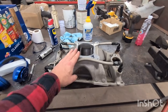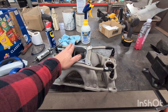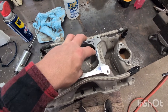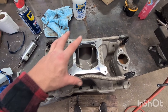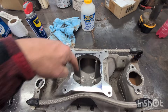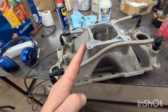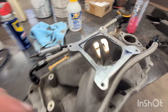So as I'm waiting for stuff to cure, this is what we're going to be working on. This is going on a 421 small block Chevy pump gas hydraulic roller setup. This is not going to spin a tremendous amount of RPM. We are going to establish a little bit better plenum inside here — there are some pretty basic tricks you can use to free up the horsepower. We are not doing a fully ported intake. I'm showing you the meat and potatoes: get this stuff out, you're going to free up horsepower. This is going to get gasket matched to a 1206 — it's already at a 1205. And then we are going to rework this area in here.